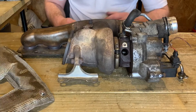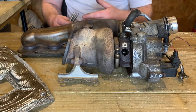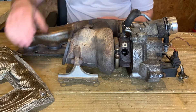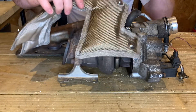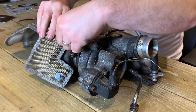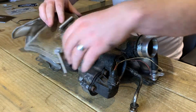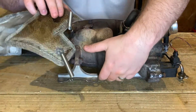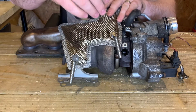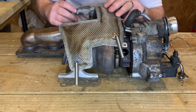So now let's start fitting. This is the bottom of your turbo and this is the top — this is what you'll see quite easily in your engine bay. We're going to start with the turbine housing, the hardest to reach area, and we're always going to start with the hardest to reach anchor points and fit those safety springs on there. First, I recommend placing this around the back and then we're going to grab the springs just after.